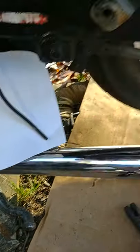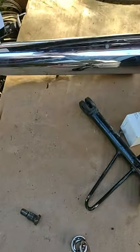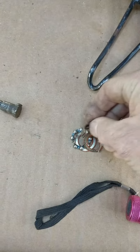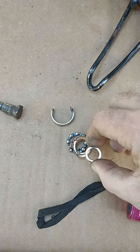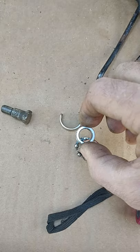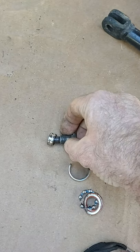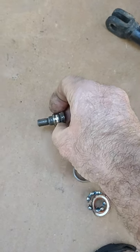What you want is only the inside of the bearing. So what I did is I took the bearing and used my grinder to cut it and pull all this stuff out, because all I wanted was the inside of the bearing — the very inside of it. This shoulder bolt goes right in and fits really snug into that bearing.